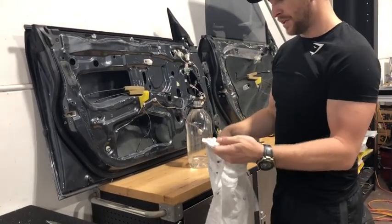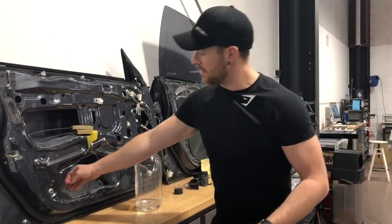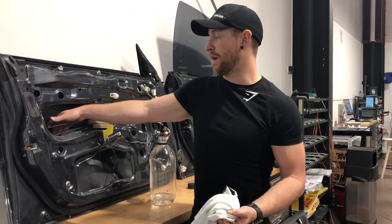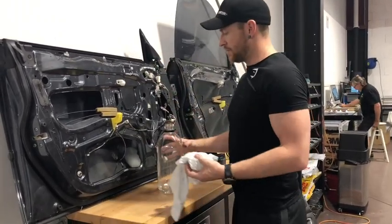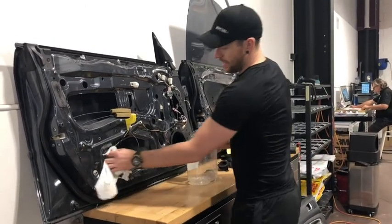We're going to go through and quickly clean all that, but it's important at this stage that you actually want to clean the inside as well, because we're adding a liner inside of the door trim — the door panel. The reason is that outer panelling is often quite thin, and a lot of that introduced outside road noise is what affects the new stereo system. So let's go through and clean that at the same time.